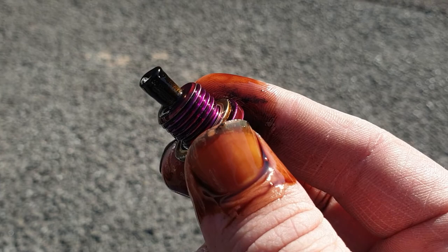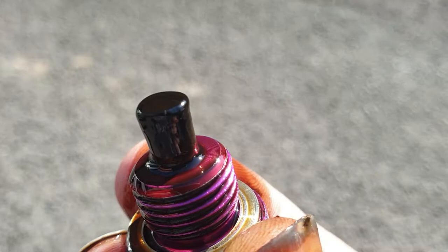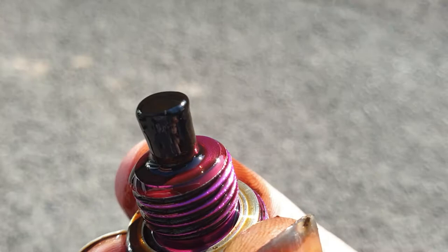I'm not going to record under here because I haven't got a lot of space. This one that was put in from the last oil change when I bought it — I remember being told about this — it's a magnetic one. With these you just want to look for anything peculiar like any large metal shards on the tip or anything. In this case there's nothing really there, so the oil isn't as bad as it could be. It's a gingery brown but it still needs to change at the end of the day.